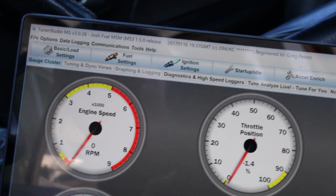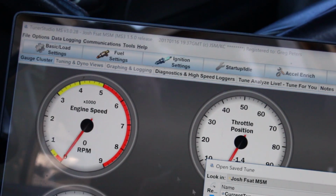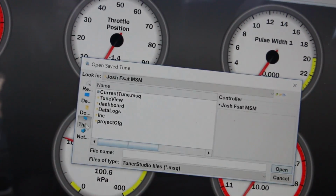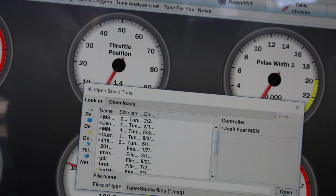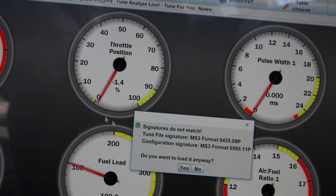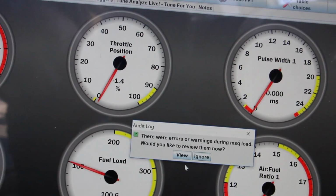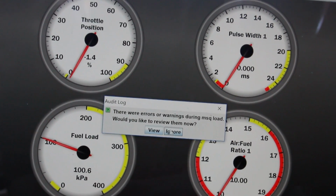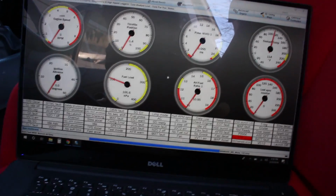Since this came out of another car, it's got an unknown tune in it. I'm going to load a Mazdaspeed Miata base map that I just downloaded. I'll include a link to that down in the description. Looks like the map might be a little older than the firmware that's on this Megasquirt, but we'll be okay. Let's see if she'll start.